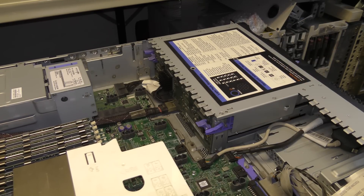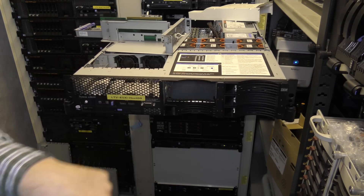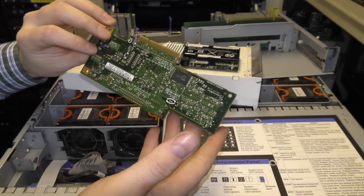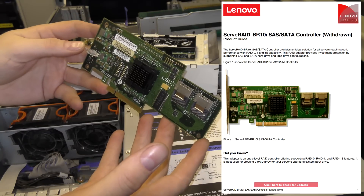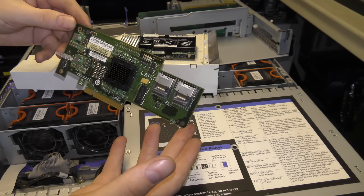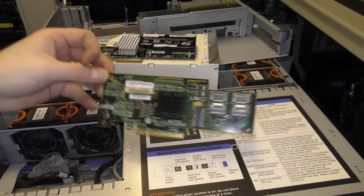Right now I only have one drive in — a 300 GB SAS drive — with five bays unoccupied. I was hoping to put in this RAID controller: the standard BR-10i that shipped with the IBM x3650 model 2. It can control eight SAS drives, but I just read online that it's also limited to two terabytes — or 2.2 terabytes. So this wouldn't get me very far and I'm probably not going to try it. It's a real shame because these are really cheap and I have a couple laying around.